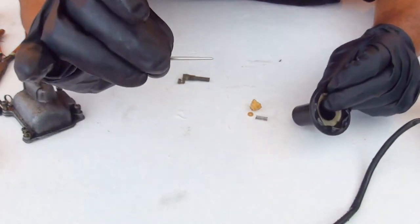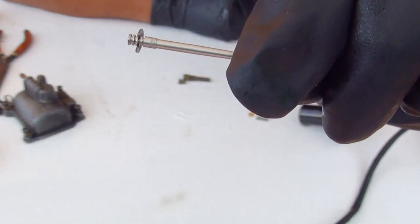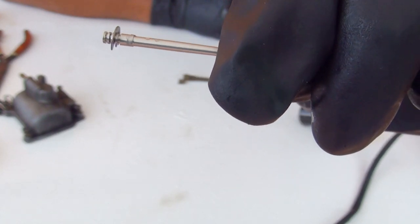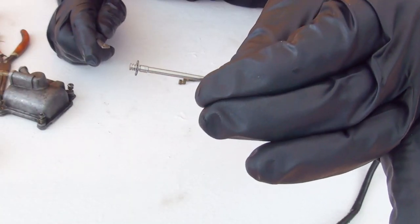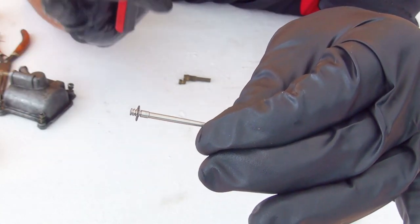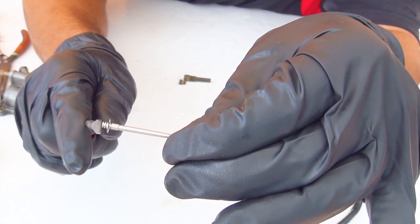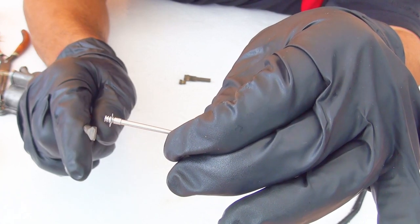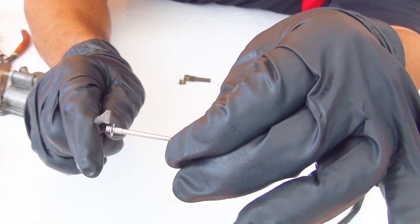Right after you remove the needle from inside, you are going to see the needle has a little clip right here. Usually this little clip is on the center adjustment — they adjust it on the center. Right here, that is the middle. If you like to adjust the needle to have leaner or richer fuel at three-quarters of the throttle, you need to move this clip. Moving the clip higher to the next level is going to make your fuel leaner, because you are dropping the needle a little lower. If you put this clip a little lower, your fuel is going to be a little richer.